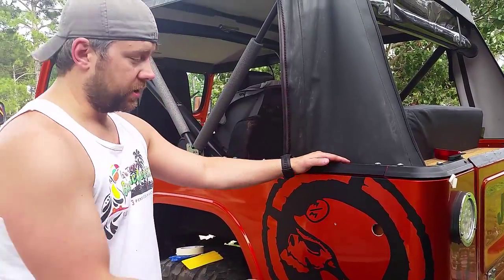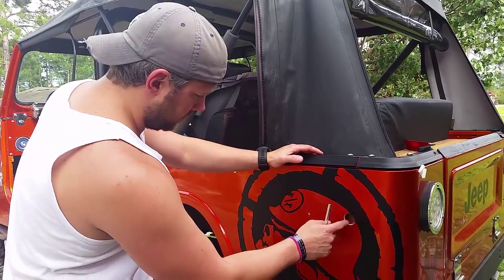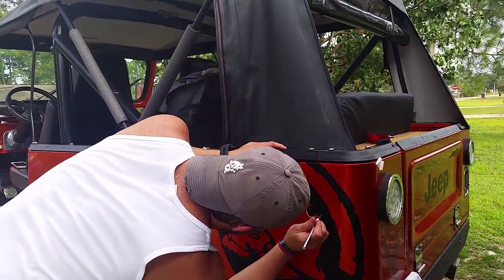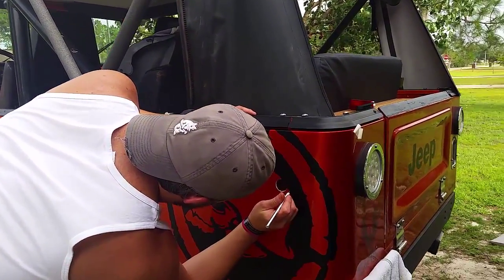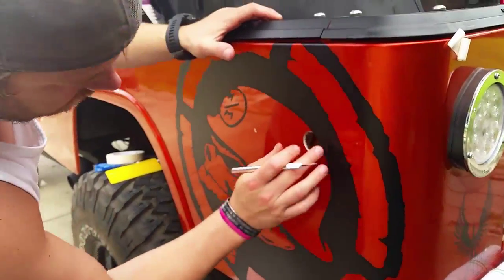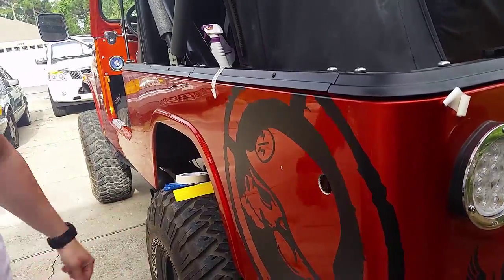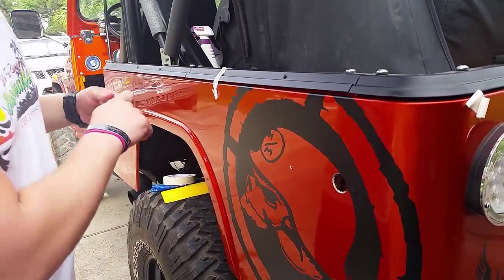Just to finish it up, I'm going to put the light back on. If you've covered up any holes in the body, you can use a knife and cut a little hole out. You can cut a little X in it, and then you can put your screw back in. And other than that, I'm just going to put the light in